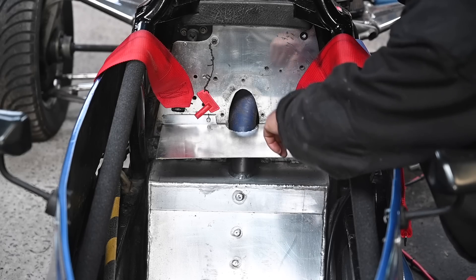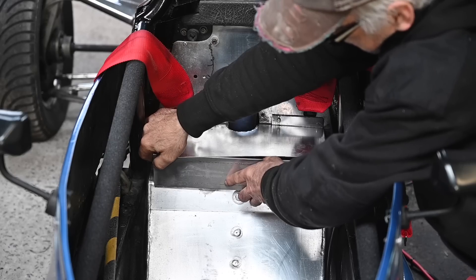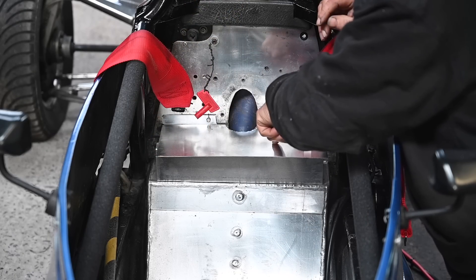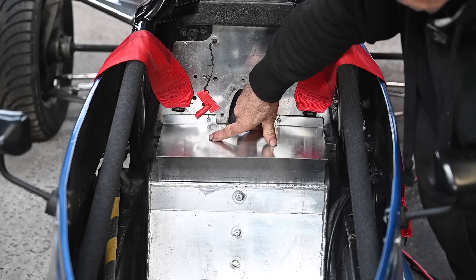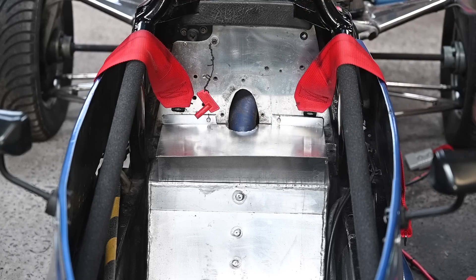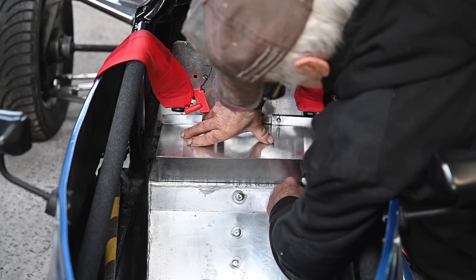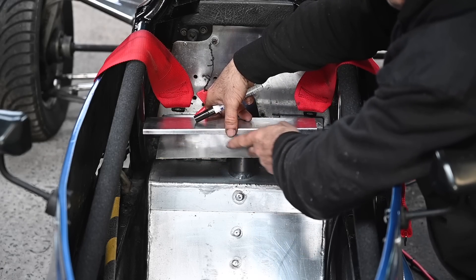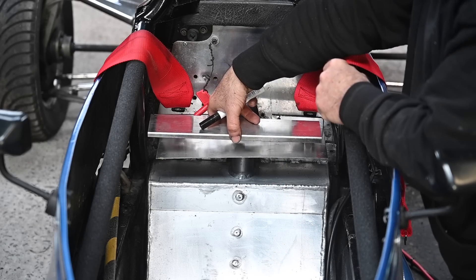This is a panel that I already have pre-bent. The part we just formed on the bench is going to go underneath like so, and then I'm going to lock it down with some rivets. I could also weld it, but I'm not going to do that. This is going to provide a pretty strong support for the seat, which will slide over this partially. On the bottom I'll install an anti-vibration piece of plastic so it doesn't rattle on top of the fuel tank, which is a thick piece of aluminum and pretty solid.